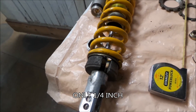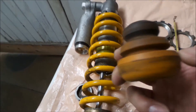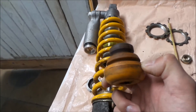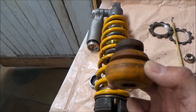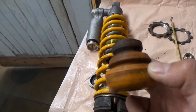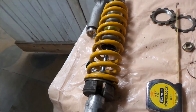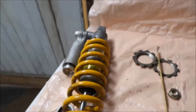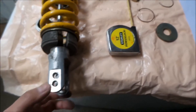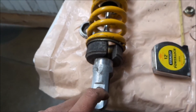So that's how they keep the bike from bottoming out. Of course, this bump stop is supposed to be here, and it's supposed to limit travel — it's supposed to bottom out before the wheel hits the fender. That's what this is for. You want that to happen. You don't want what happened to me to happen to you. So if you do lower your bike, don't just drop it a bolt — you've got to flip this collar around so it can bottom out properly.